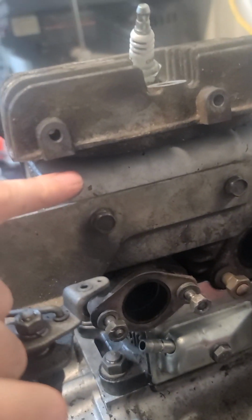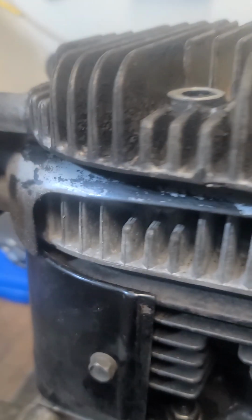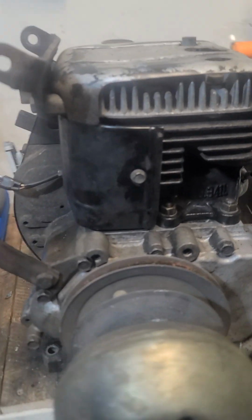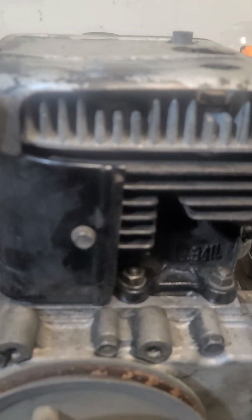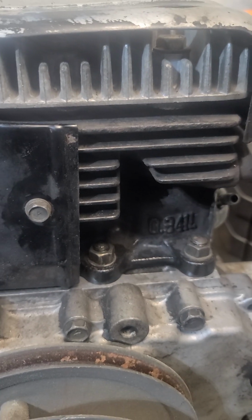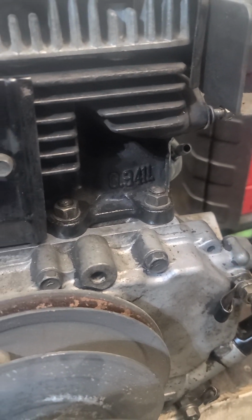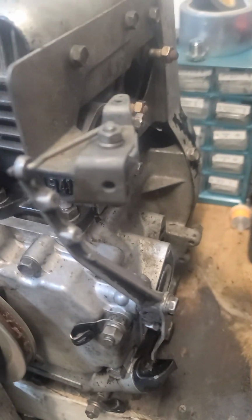All the mounting stuff is the same for the covers, and you have to have these covers on here because that's what helps keep the motor cool. All it's got to cool is the fins off the flywheel. I wanted to show people that because that kind of blew my mind. It's gonna work fine, I'm not worried about that. But I've got to cut my cover. It's not something I really wanted to do, but here I am. I'm the one that ran into it.